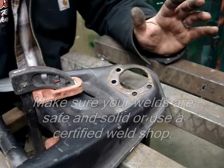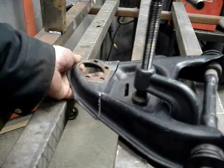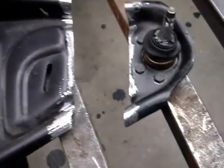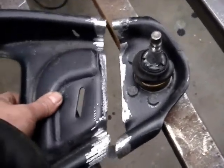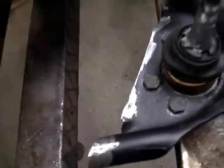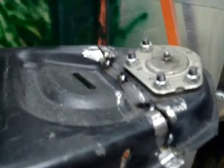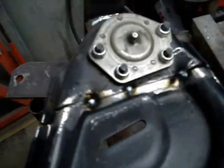Because I don't even know if this is going to be the right camber or caster or whatever. And here is the A arm cut. Now I'm going to go ahead and reassemble my ball joint. Once you have all your mating surfaces cleaned and free of any paint, oil, or grease, that will also aid in having a better weld. You can just see I've got some tacks just to hold it in place.